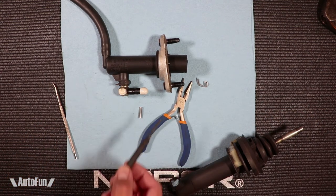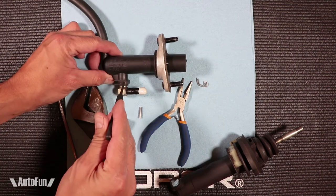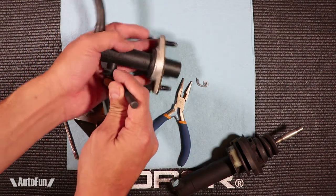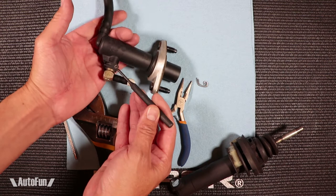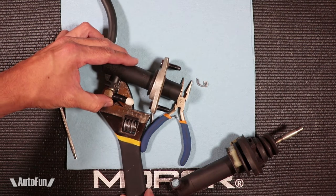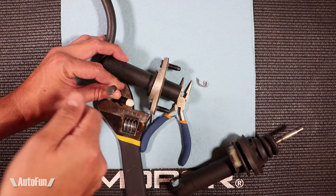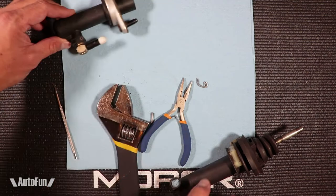In order to get that roll pin out, you have to punch it out. I like to use a punch that's about the same size as the roll pin. I've seen pictures online of people who have done it incorrectly — there's even a picture of a guy who hammered down the roll pin and drove it into his hands, which is probably not a pleasant experience. So what I do: I set the slave cylinder over an open surface so the roll pin can fall down as I press or hammer it out. Once the roll pin has been fully extracted, you can pull the line straight out.